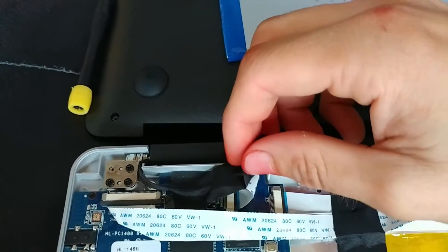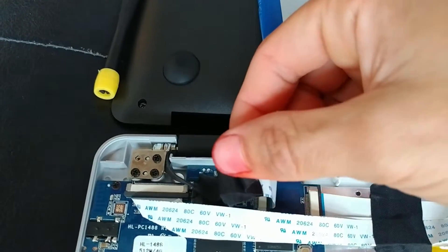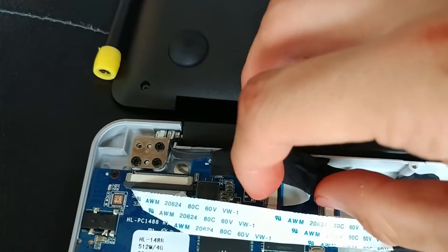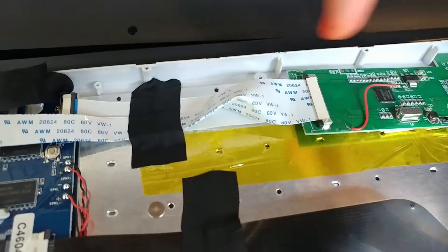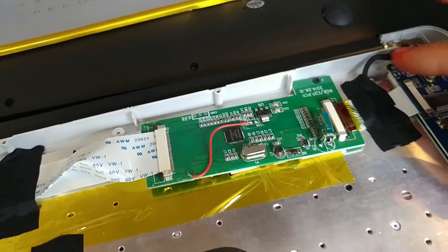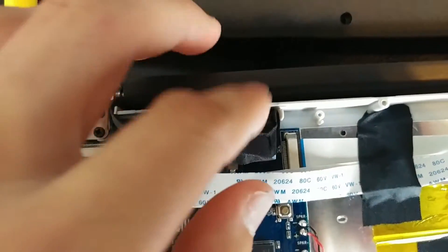Here is the cable through which the power for the backlight goes. So I'm gonna pull back this tape if I can, without covering everything. I need to get a proper tripod. I'm not going to pull off the tape anymore. What I'm going to do is re-seat — just unplug and plug back in — that flat flex cable, and for good measure re-seat this one as well. That thing took way longer than I thought it would to get back in there, but it's back in there now.